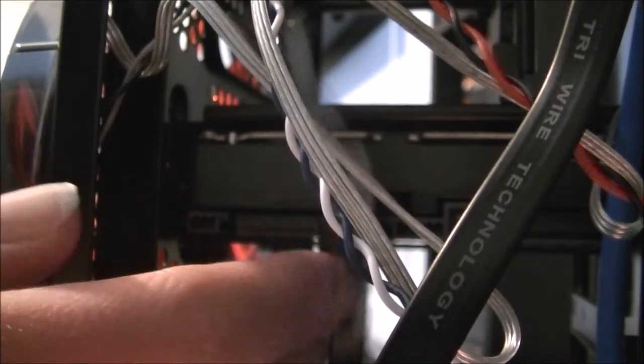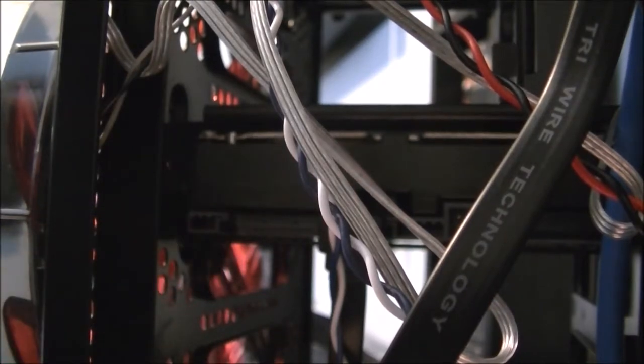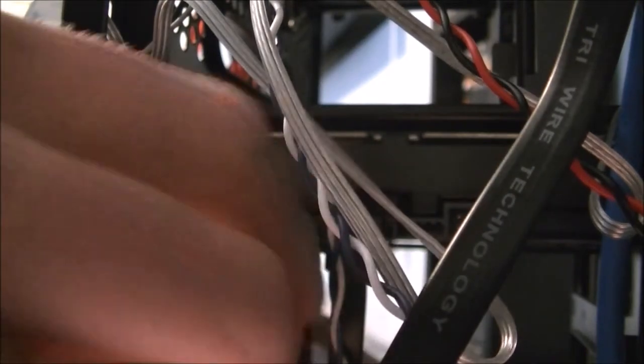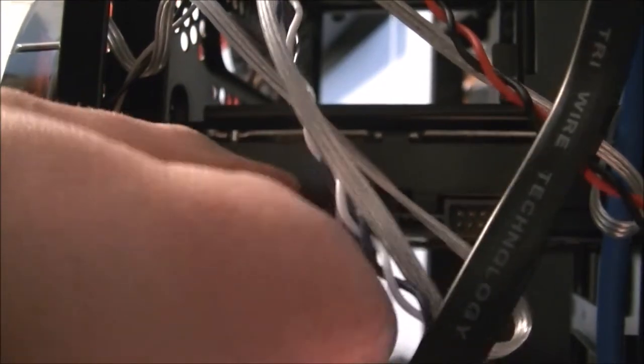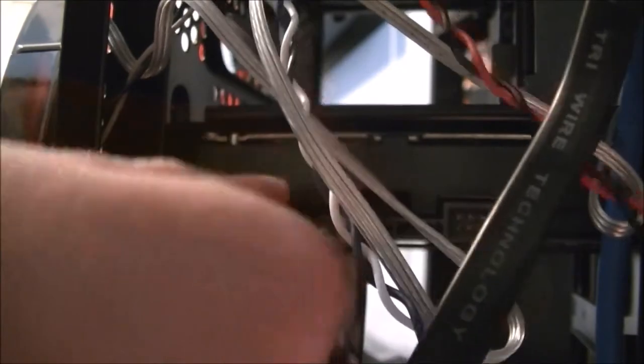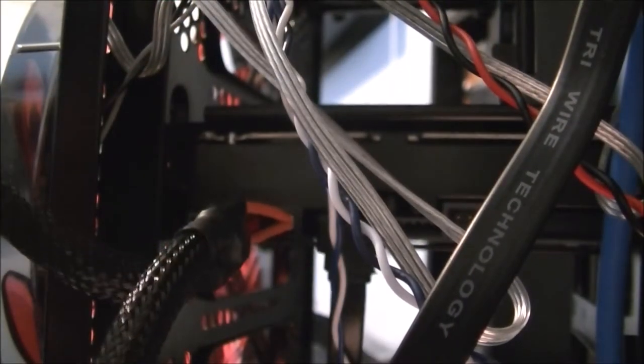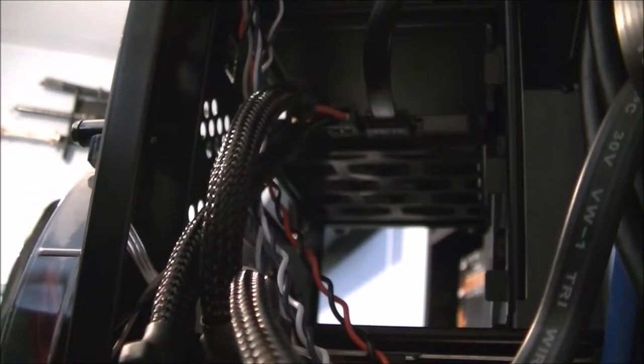Here we have my Western Digital hard drive and the SATA power plugs in here. I'll just grab that a moment. This end. Yeah, I'm plugging it in the right one. It's a bit stiff to push in. And then I've got to plug into the SSD up there. That one's in as well. Okay, so that's the hard drive and SSD plugged in.